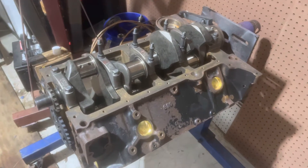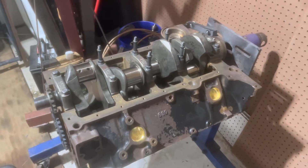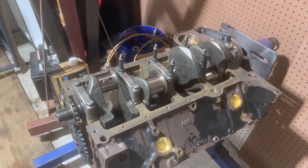That's a step that you might say wastes time, but it needs to be done. It's the proper way to build a motor — just check your clearances. If they're too loose, I'm building a bad motor. If they're too tight, it wouldn't spin, so the spinning proves they're not too tight, but I do want to check it's not too loose as well.